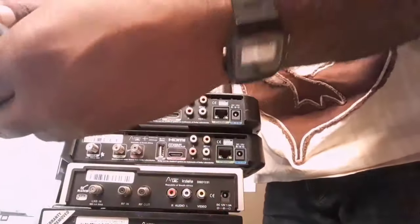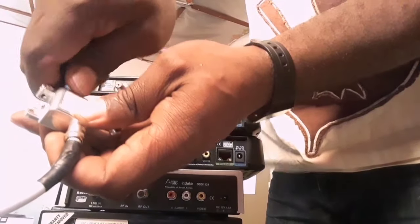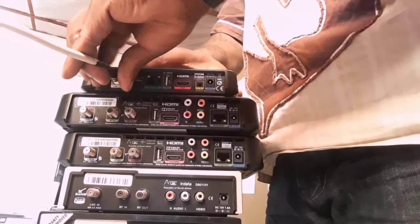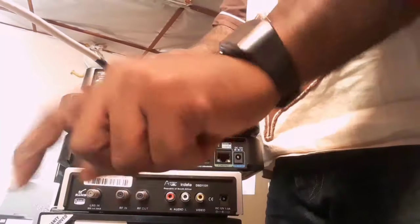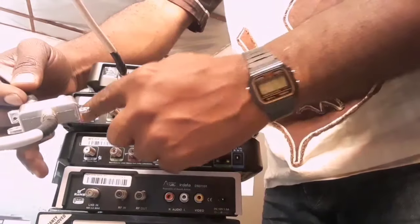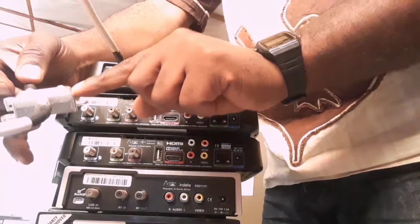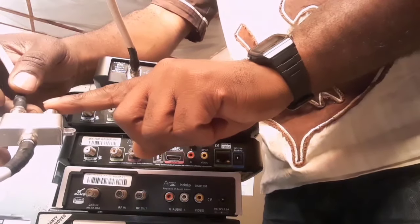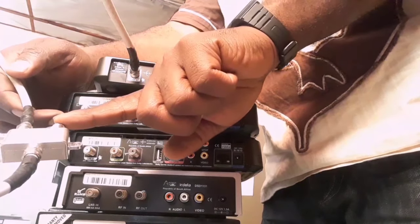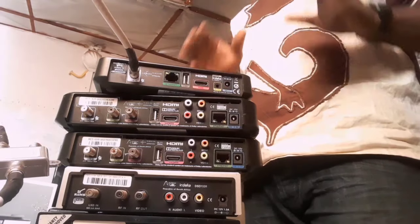Make a short cable, put it on the SAT connection of the diplexer, screw it on SAT, and then put that cable into your new decoder — the one which has only the LNB input. The cable that used to connect to the old decoder's RF, you put it in the IN on your diplexer. The antenna port on the diplexer — that will be your heartbeat cable, so the other cable from the secondary decoder sits there.